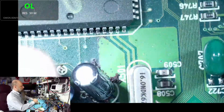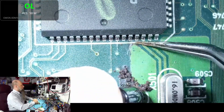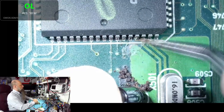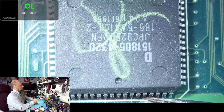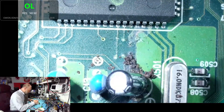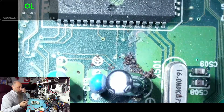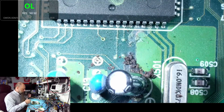This capacitor is on the MCU side. A concern is whether this is a ground trace that is now not making contact with the MCU — that's going to be tough, because I'm not familiar with this ECM. On the B2600 I know the board and I know which traces go bad and where they should go, but on this one, not so much.